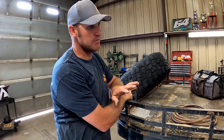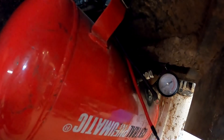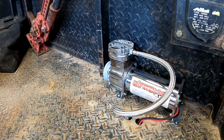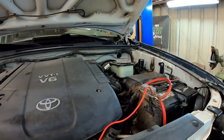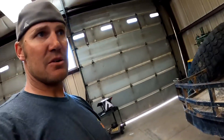So I've been getting my air system all done. Tank's mounted down here, it's all put in and plumbed — everything's good. Got a little gauge under there so I can see everything. Got my port and my pop-off valve down here. My compressor's sitting right there. I still got to get a couple rubber grommets, but we're gaining. I'll go wire this thing and see if it builds air.